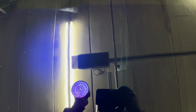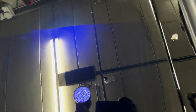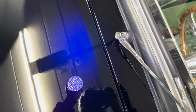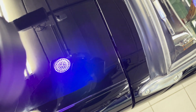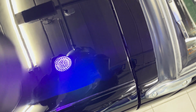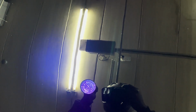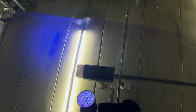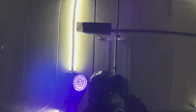Like this spot. This darker blue line in the coating is called a high spot. A high spot has too much thickness compared to the rest of the coating and will show as a darker spot in full sunlight and under ideal lighting conditions. A high spot is technically okay, and although it may even outlast the rest of the coating because it's thicker, it's aesthetically undesirable. The rest of the coating looks pretty even though. No reason to panic if you notice a high spot immediately after applying the coating.